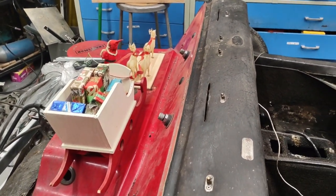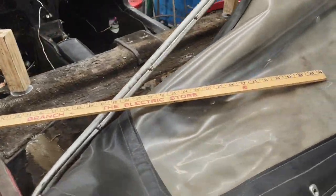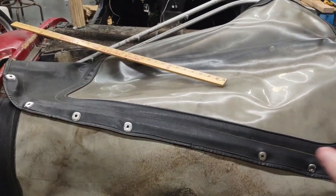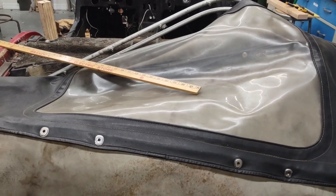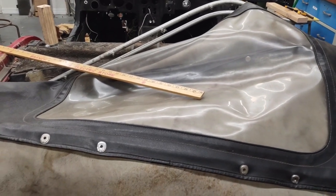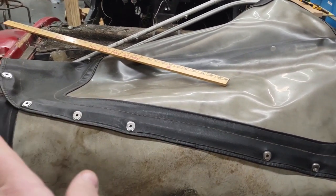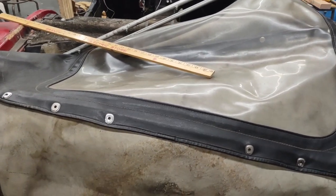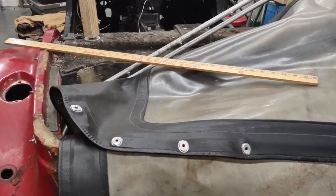The chassis in the back end is 7/8 of an inch off to the right. So it's off center line, 7/8 that way to the right. It's bent that much right now. Was it worse? I have a feeling that since it was hit on the right, it was bent a lot that way and they overcorrected it. Anyway, they're establishing what needs to be made, what parts.